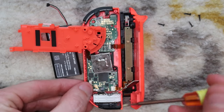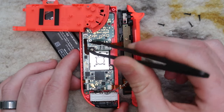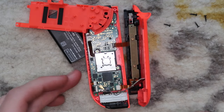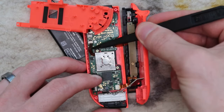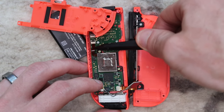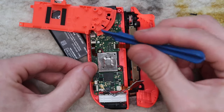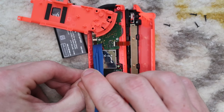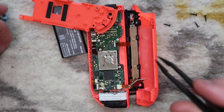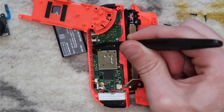Now we're going to reinstall the two Phillips head screws. Then we're going to place the ribbon cable back into where it came from — this can be tricky. The best way is to grab it right by the neck, pull back a little bit, get it into the hole but not all the way in, then take the plastic spudger from the back and slide it in. There's a little piece of plastic on the ribbon cable you can hook onto and push it in, then lock the ribbon cable with the little black lock by pressing it towards the board.